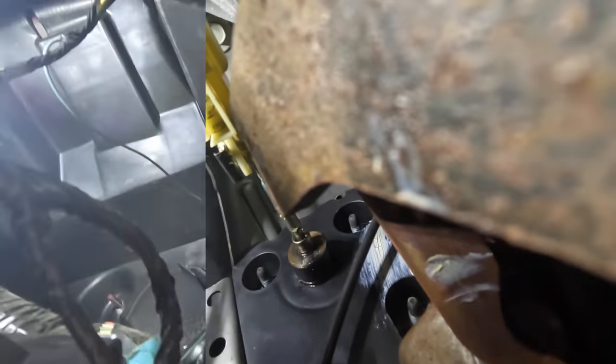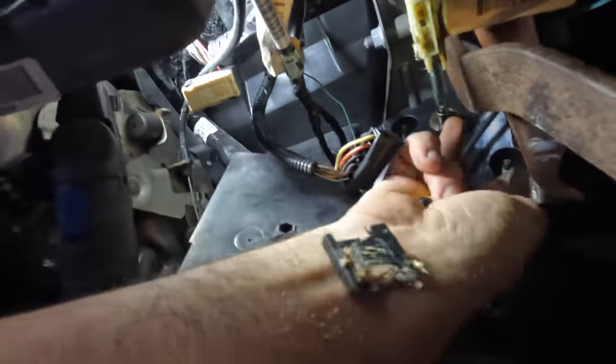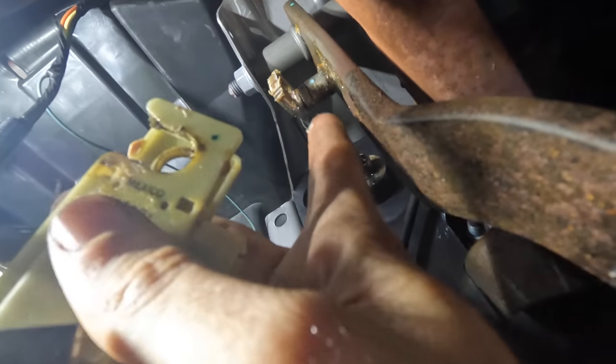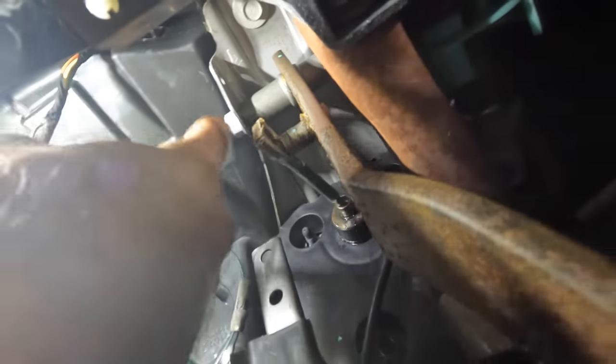This is hard guys, this is real hard to do. Still in here prying around. This thing's got to get pulled back and unclipped, and now it's pointing the wrong way. This is hard. I don't enjoy working under dashes. There we go, got our clip - wrist clip. So now reaching here, kind of wiggle this thing over. Come off. All this lube - I don't like it. Let's see here, so we're going to give this thing a tug. There we go - we'll pull the switch off. See how that slips over the pin on the lever? It's the brake pedal lever. So this thing slips over - that's the rod for the brake booster through the firewall, and then the switch slips over that as the rod slips over. And that kind of gives us a better view on our nut that we need to get off.